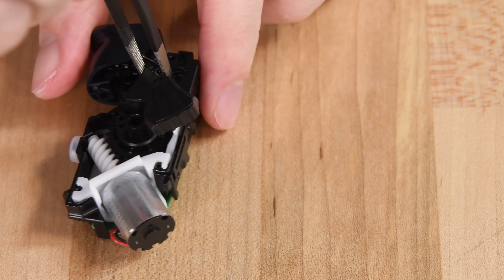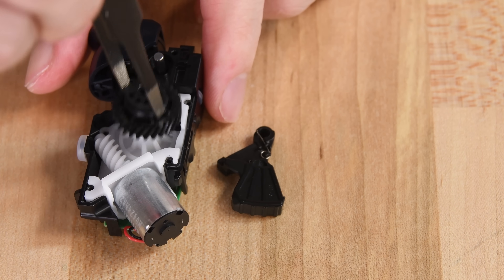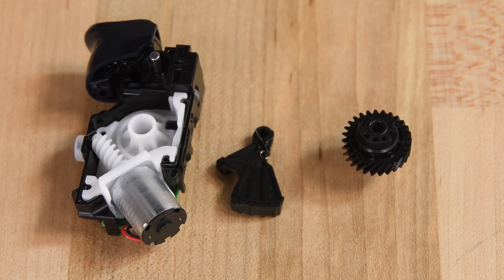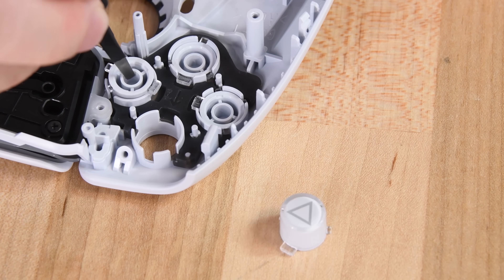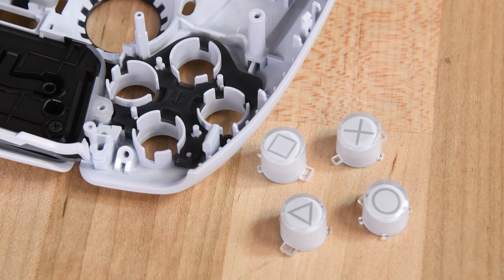This adds another level of feedback and input to the button and to the game. It'll be interesting to see how this part holds up over time. The good news is most of the components within this mechanism are modular — the main gear and connecting arm pop right out, and even the motor can be replaced independently if you're handy with a soldering iron. The face of the controller houses the various buttons and the trackpad. The buttons are all very easy to remove, so when they inevitably get stuck, it won't be too hard to pop them out and clean them.